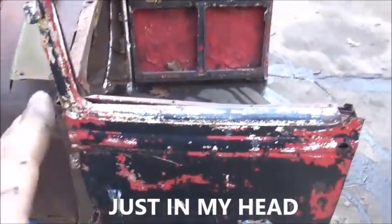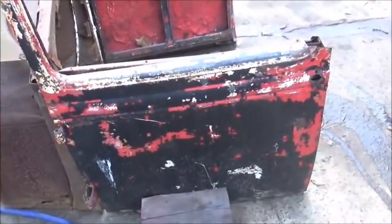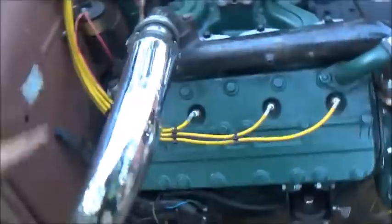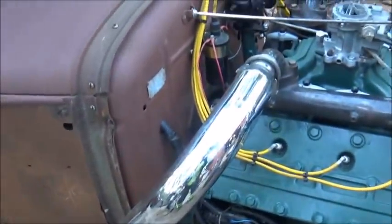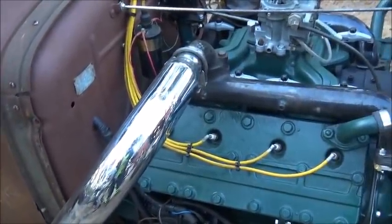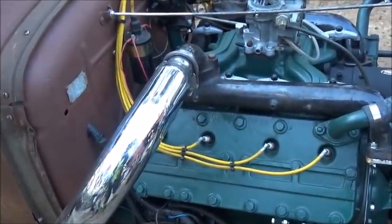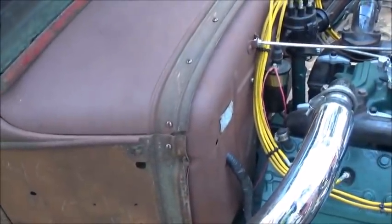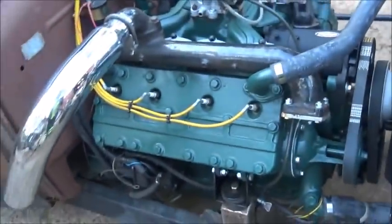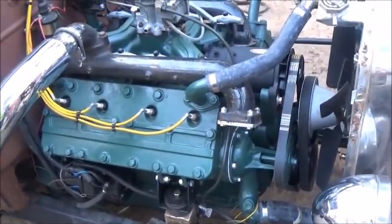And just so you know, I've already driven this thing down the road and back three or four times now. Kind of hard to get in third gear, but it'll work. Transmission worked fine, clutch worked fine, everything on the 5-speed conversion worked out just fine for the Cadillac. No issues there. Tacked it up, popped it in second gear, spun the tires, took off, no problem. Gear pretty low, so you run out of RPMs really quick. So you're shifting fast and taking off in higher gears, I guess, but it does really good. It's not lacking for power in any way, shape, or form. So everything's working out good, and we'll keep at it.